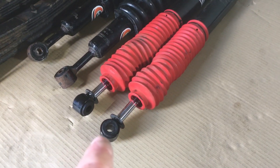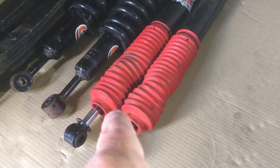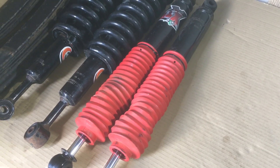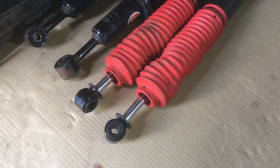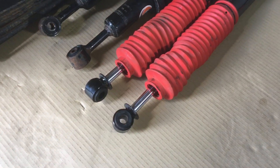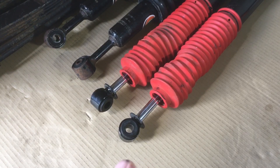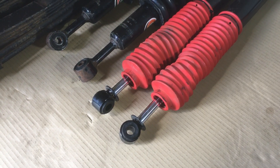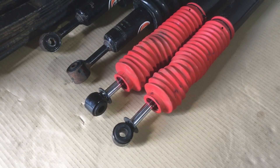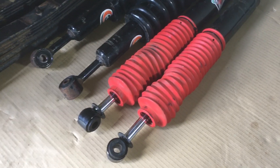This is pick-up only. The rear shockers are working well - gave them a good bounce test. You can leave these boots as they are. All I would do is cut the zip tie at the top there - they go in with the boots at the top. Cut those zip ties, allow the boot to slide up. You can't see any cracks or splits in here - they look alright. There's a couple of minor issues, but it's not a big deal.